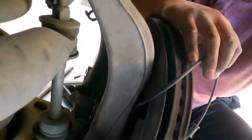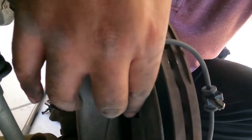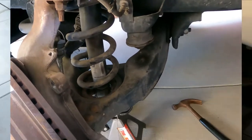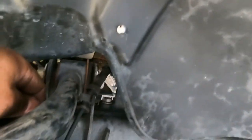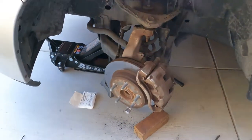Just got to make sure when you place that back plate on that you have the side where the cable is going to thread through. There's a slot in that plate right behind the rotor that the cable is going to thread through. Everything is now back in place. I even used the same clips that were on the track, clamped them in place, connected everything on this other end, plugged it in and snapped it in place. Caliper's back on and pretty tight — going to go ahead and get the wheel on.